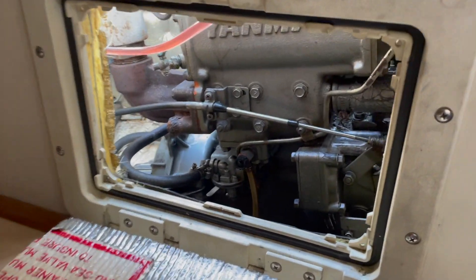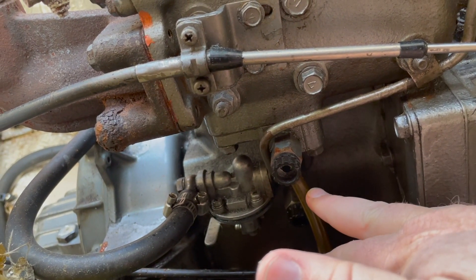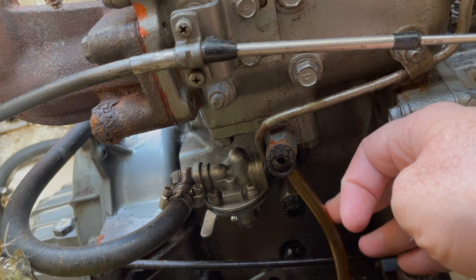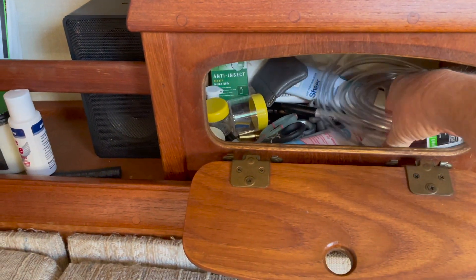This is a key side of it because here you've got a fuel pump. This is a drain petcock for the coolant, and there's another one underneath it right here which doesn't have a hose attached. Those petcocks have quarter-inch hose fittings, and this hose has an inside diameter of quarter inch, so it'll go on smoothly. We'll run them outside the engine compartment so we can cleanly and easily drain the coolant.